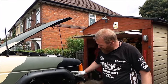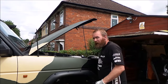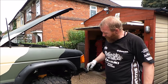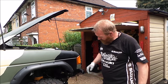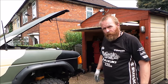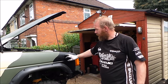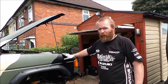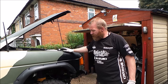Right, there you go - all the bolts are back in, the shocks are back in. The blocks are in, so I hope this tutorial helps someone if they buy any of these lift blocks to put in their suspension. All I've got to do now is re-torque all of the bolts to make sure they're all at the right torque. And that's it - that's this side done. Just got to do the other side - I'm not going to bore you with doing that. Just got to move the airbox again to do the other side.